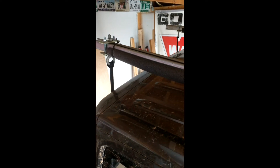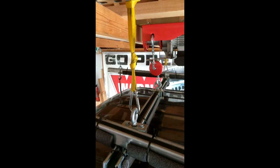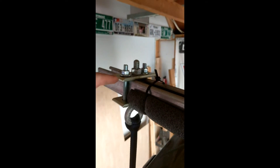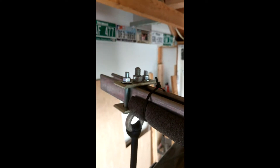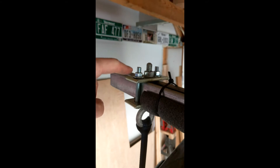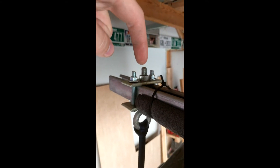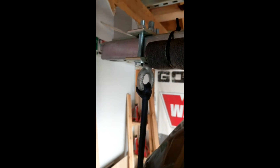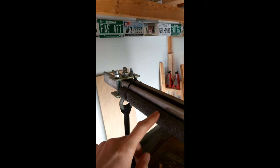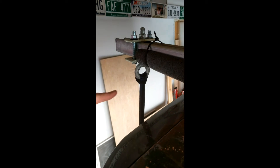In terms of components, there are a few key things. Ninety percent of this was purchased from Home Depot. The climbing slings are from REI — they're like five to ten bucks a pop. The hoist was from Harbor Freight. This right here is the fundamental unit that holds it all together. There are these two parts which come pre-drilled with holes on left and right, and you have to drill the hole in the middle. Those are in the electrical department at Home Depot. All the hardware is three-eighths-inch, with three-inch long bolts. The only thing that isn't from Home Depot is that big beefy eyelet that's actually made for lifting — rated to around 1,200 pounds — and those are from McMaster Carr. The strut is also from Home Depot, electrical department. This is plumbing department — just a little copper pipe insulation so that nothing scratches the hard top. And then these are the climbing slings from REI.